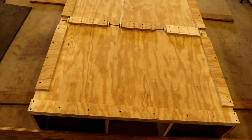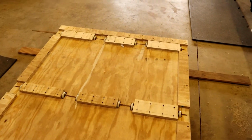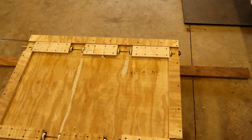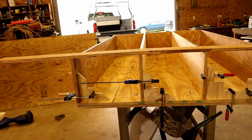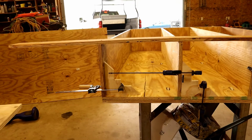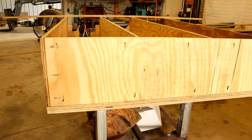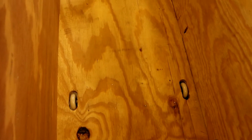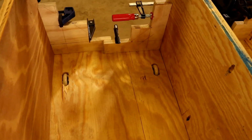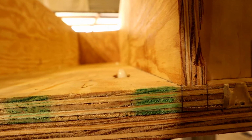Slats on around the edges. This will kind of keep debris out or keep us from losing some tools up under the box. And we also got the slats holding the wheels in, which will also give it a little support. And then this will give us an air gap up under the box, so in case it rains or any water gets in, the truck bed already has the holes to release the water that does get down in there. So over time this wood will dry out.